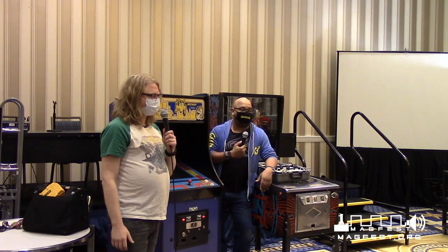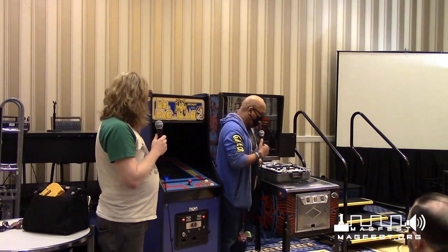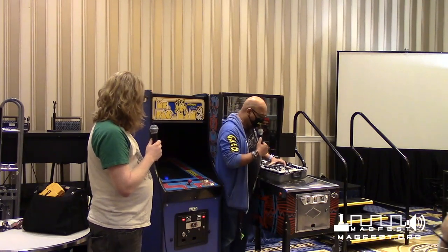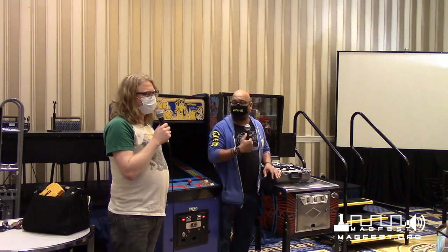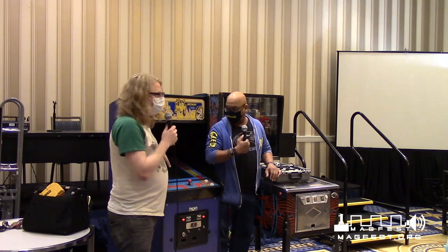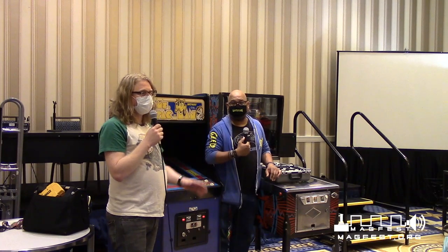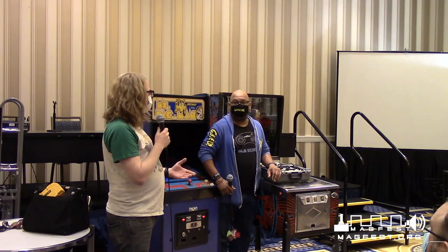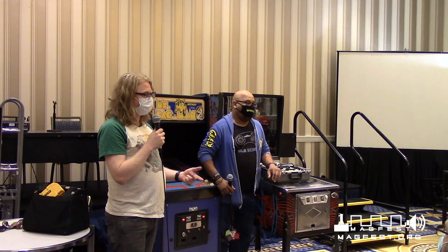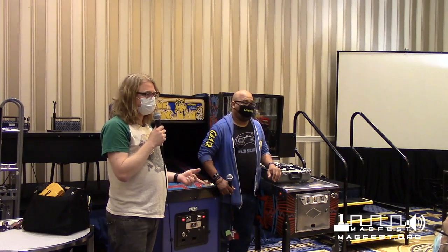But like I said, this will pull up your colors, make them a little bit brighter, to make your screen last longer. And tube replacement, actually replacing the physical tube, is one of the more difficult tasks that you're going to run into. Mostly because CRTs are not manufactured anymore. Specifically, tubes are not manufactured anymore, and so they must be pulled from old TVs.